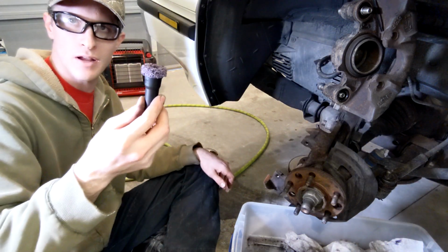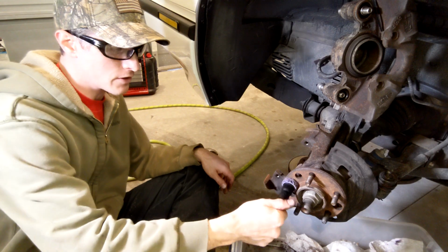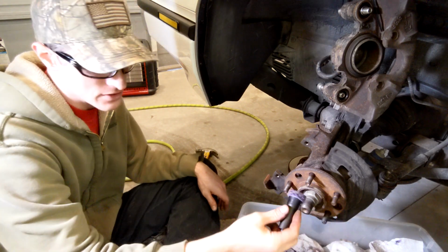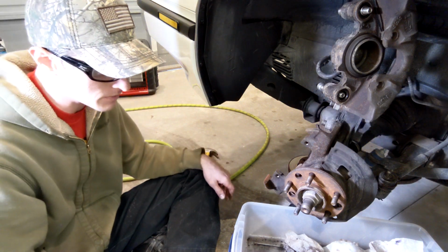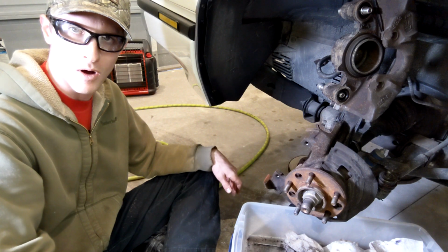I'm gonna use this 3M tool. I'll put a part number for it in the description of the video, but what it does, it goes around these lug nuts, studs rather. And it does a really nice job, really gets in here well. You can use it to clean basically the whole thing. I probably will on this car, just to keep things simple. But if you don't, it can cause our new rotor to wobble a little bit.